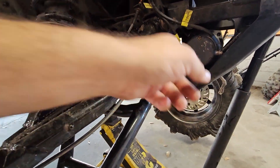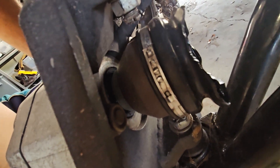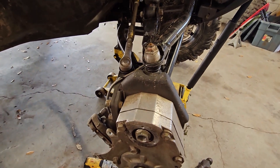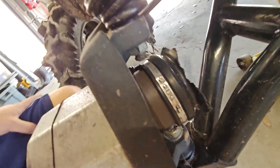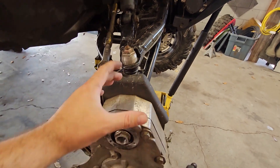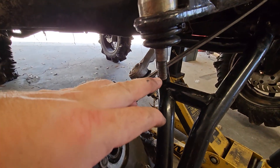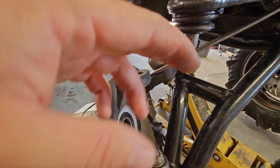I've got to get this axle out of here, but the hole right here in the portal bracket is not going to be big enough to fit a Demon cup through — that's how my 8-inch Talon portals work, but not these. So I'm actually going to have to separate a ball joint. Sometimes you can just remove the portal box and slip your axle in through that hole. I went ahead and separated the upper ball joint very easily — loosened the nut, took it down a few turns, smacked it right there, and then removed the nut the rest of the way.